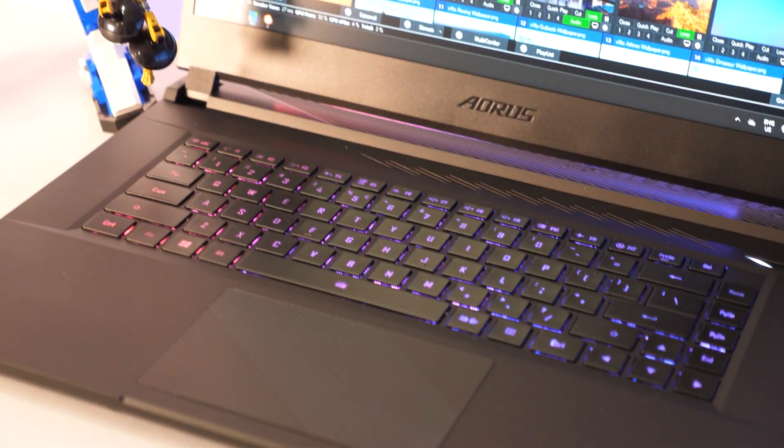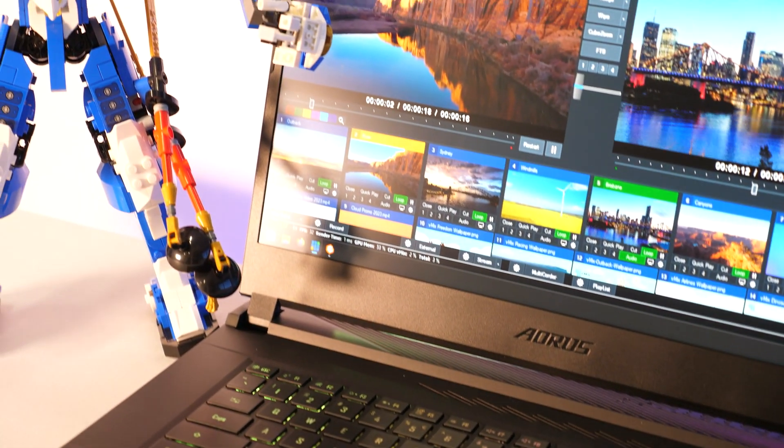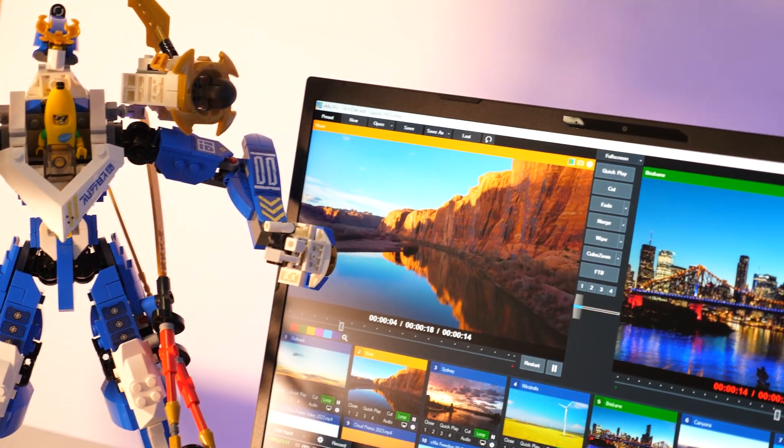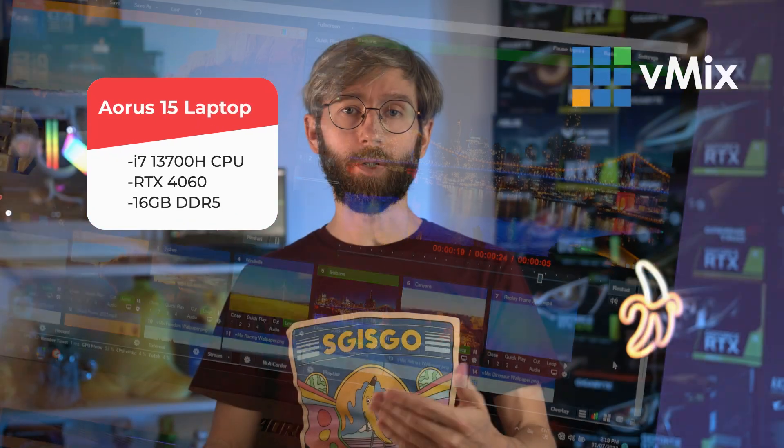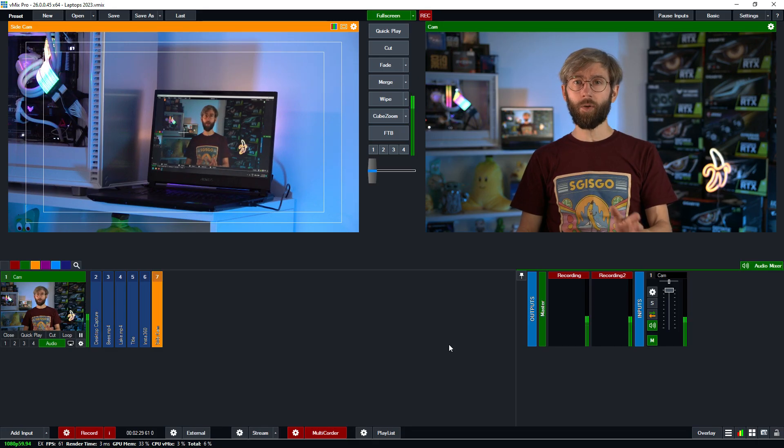For the most part, having a good gaming laptop with a dedicated GPU, a good CPU, and a MUX switch will work well with vMix. The laptop we've selected has all of the latest gear for 2023: a 13th gen i7 Intel CPU, a 4000-series GPU, and DDR5 RAM. To be honest there wasn't a huge upgrade from our previous recommendation in 2022. The main thing is the 4000-series GPU, which will allow for AV1 encoding in the future when vMix supports it.